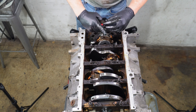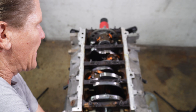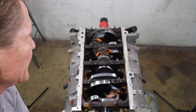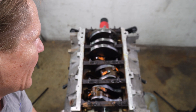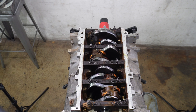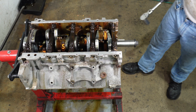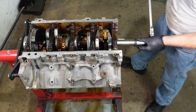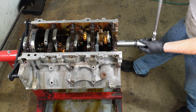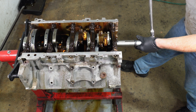The main cap goes on facing the same way — the numbers confirm orientation. Now that all the bearings are in, we'll just roll the motor one or two times to make sure everything feels smooth and nothing feels like it's in a bind. Everything feels really nice. From here, we'll go one by one — tighten down all the mains, then tighten down the rod bearings, verify we still roll nice and smooth, and then we can move on to putting the cam in. The motor is all buttoned up, everything's torqued down, we've poured oil across everything to keep it all wet, and the entire rotating assembly turns nice and smooth — no binding, no dragging, no scratching, no scraping.